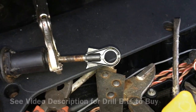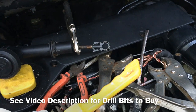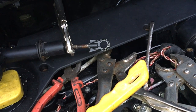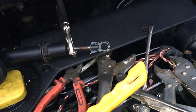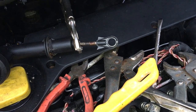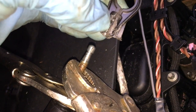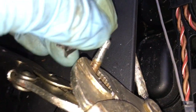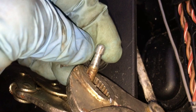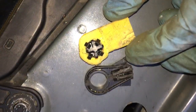I'm going to make it 5mm longer, which will give me about another inch of extra movement at the pedal. You can always make it shorter or longer after trial fitting, either by padding the hole or by drilling the hole a little bit deeper. There's the piece of plastic removed - had to cut a little slot with the angle grinder. You can see the end piece of metal is wider at 6.5mm, which is why it wouldn't just pull off.